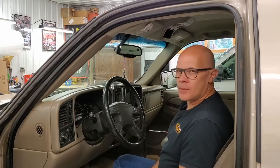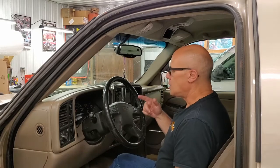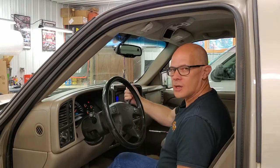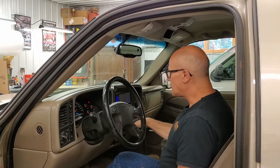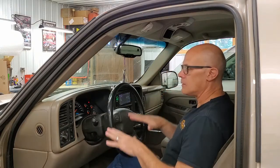So it's pretty simple. The first thing you're going to want to do is push your parking brake, because you're going to be putting it into first gear and you don't want to roll away. Put your foot on the brake, turn the key one notch, and drop the shifter all the way down to first so it's out of your way, and tilt the steering wheel all the way down so everything's out of your way.